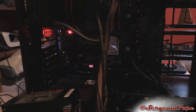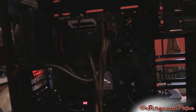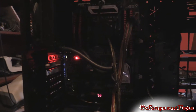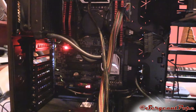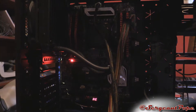It's still booting — the code is D6, which I think is because there's no graphics card installed. I looked it up and it was like 'no output or something.' But it's at least turning on. It's still kind of acting funny every once in a while, like it just shut back off but now it's fine. Could be because my power supply honestly isn't enough wattage for such a powerful CPU — 430 watts might not even be enough. Anyway, maybe I'll look into replacing the power supply for my customer, which would kind of suck because that's a nice power supply, but I'll keep you guys updated.